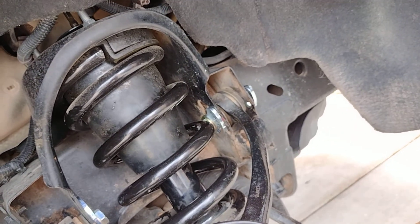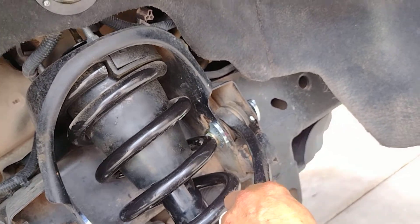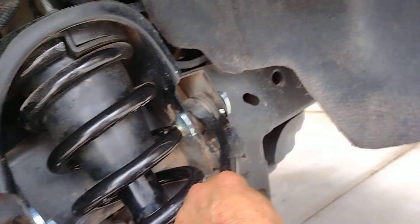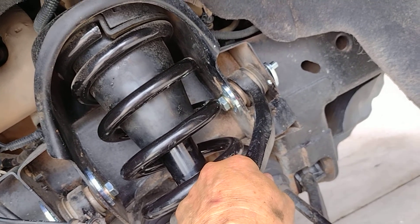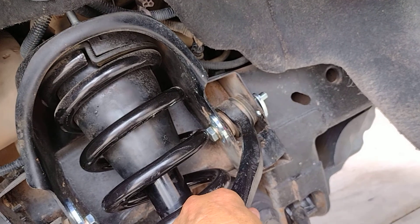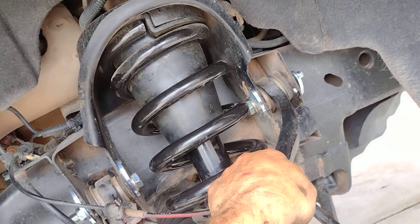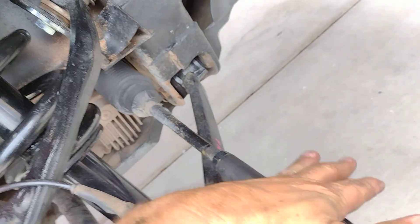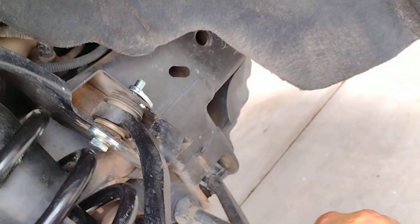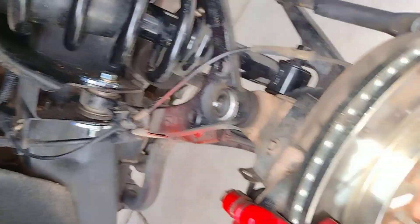It's easy to put on. I did the control arms back in November or so, and I needed to get an alignment, but my previous tires were already trashed — I didn't want to do an alignment and then have an issue going forward. In March of this year I replaced the struts and bought four new tires, and I asked for an alignment. Unfortunately, when they aligned it they only aligned the toe — they did not align the camber. I guess you have to specify that you want the camber aligned when you walk into the shop.